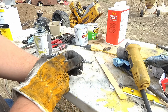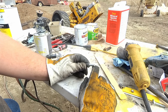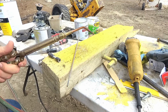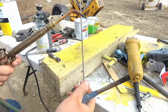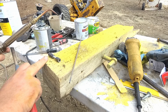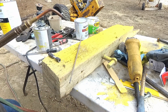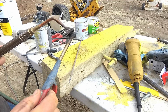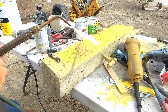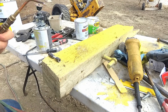I don't know if you can see that little mark right there — that's what it needs to go into and that's what needs to be welded in. I'm going to try to torch weld this in; I think that'll be the best bet. I'm using the torch with a brazing tip and just a 60-11 welding rod. This side here needs to be brazed or welded, and I put the other half on this side to keep it halfway level. I will say I'm not the best at torch welding, but we'll see how this goes.